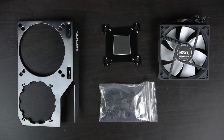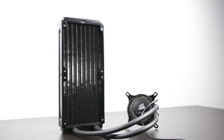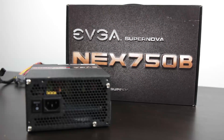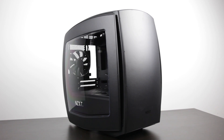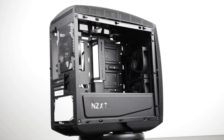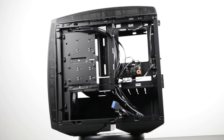We're also going to be doing a little bit of overclocking on our 980 Ti, so we're actually going to water-cool it using the NZXT Kraken G10 adapter, which basically allows you to water-cool any of your modern GPUs. We're pairing it with a dual 120mm all-in-one water cooler. For the PSU, we're using the EVGA 750W 80 Plus Bronze Certified Half Modular Power Supply. For the case, we're using the NZXT Manta — an ITX chassis that's portable and unique-looking with reinforced steel curved panels, very rigidly built, easy to work with, and supports two 200mm radiators, perfect for all the water cooling in this build.